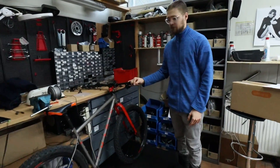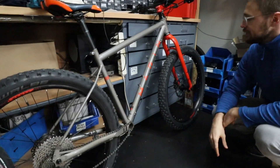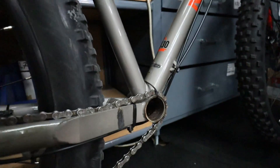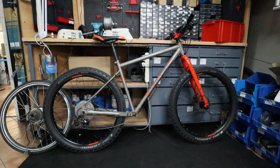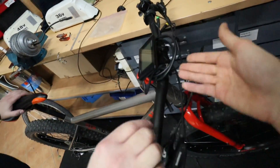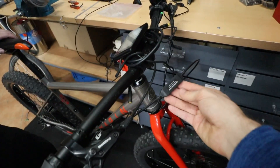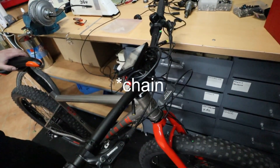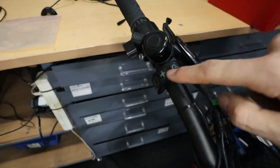That is the bike we're going to perform the conversion on — there's no motor inside yet. Basically all bicycles are ready for an e-bike conversion depending on parts and configuration. The cables aren't routed yet. There's a gear sensor that won't allow the motor to turn while changing gears, so you don't break them. The throttle is on the left side along with the on/off switch and mode selector.